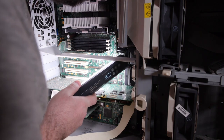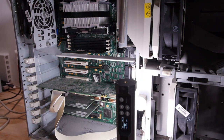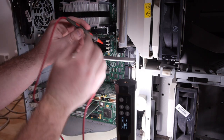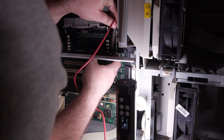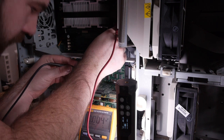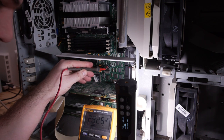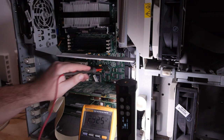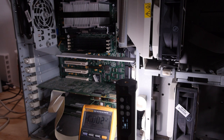It looks soldered! That would really suck because then I'd need to take out the motherboard and go to Dave Pennings for repairs. But at least we can make a video about it. Let's try to measure it anyway — plus here and minus on the chassis. We have 2.925 volts, so there's some charge in the battery. Let's push it back — it's probably just working and there's something else wrong with the system.